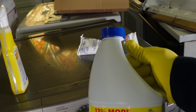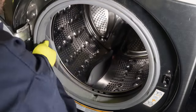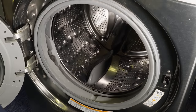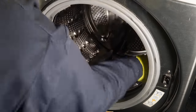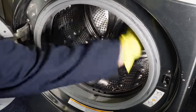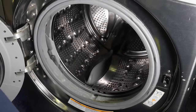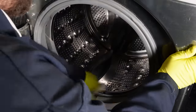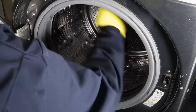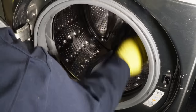So now it's time to start in with the heavier secret cleaning products. I am now taking my low splash bleach and pouring it on the door boot seal, rubbing it in with my gloved hands. You could possibly use bleach spray in a bottle for a more uniform soaking, but I didn't want to overspray bleach in the unit, as bleach tends to be pretty bad for metal in most washing machines. Also, as I run my hands all over the door boot seal applying the bleach, I'm finding tons of lint trapped in the rubber seal that didn't go away with scrubbing, especially at the top. You want to soak the entire seal with bleach, especially the areas where you have the worst black mold still apparent.